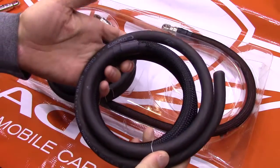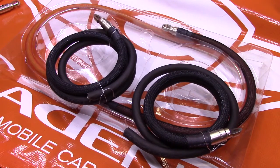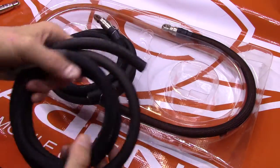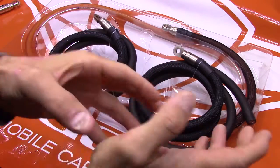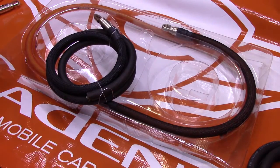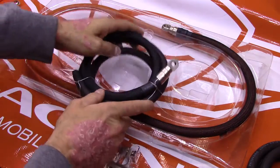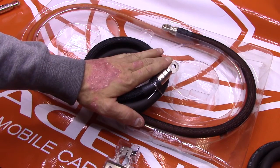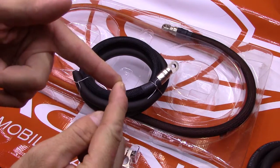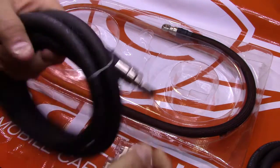One of the things we do here is we redesign or reset up the power system underneath the hood. First, we're going to take one of these cables and connect it to our motor — a solid connection point on the motor. We don't want a painted surface; we want it clean, not on brackets. Something on the block or something actually attached to the alternator, because the alternator is where we get all our power from. The battery is simply a storage medium; the alternator is what produces everything — our current and our voltage. Then we take the ground cable and connect it to one connection on the ground side of the battery terminal. The second one we connect to the body of the car. This is really critical — you want to find a solid piece of thick, heavy steel, drill a bolt and nut through the body, take all the paint off on each side, and connect it down to that area.